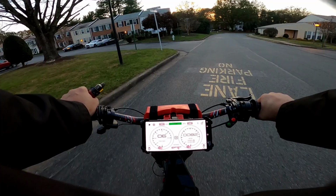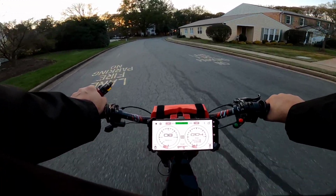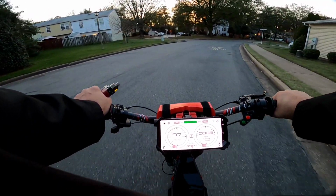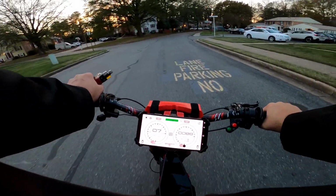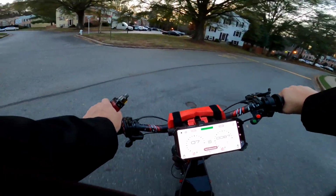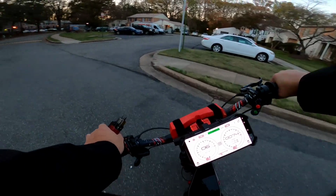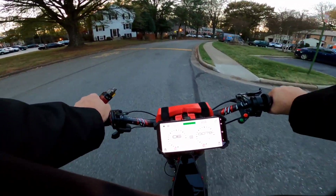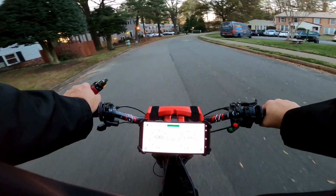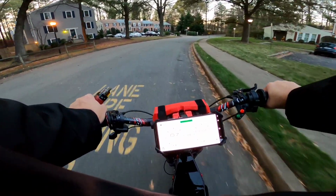So after I did all of that puzzle piece work and I had charged the bike up, I totally forgot the fact that I am now running a 23S system on a 22S capable controller. And when they say this controller is really smart, by the way, when ASI says 22S is the limit on this controller, make no mistake about it, 22S, 92.4 volts is the limit. You ain't going anything over that for sure.